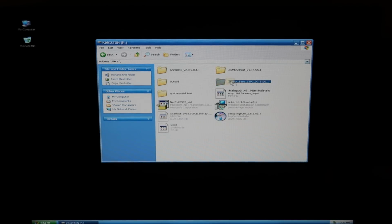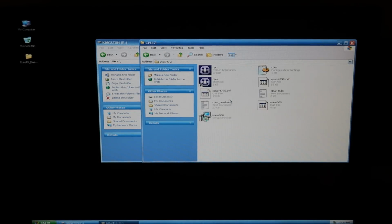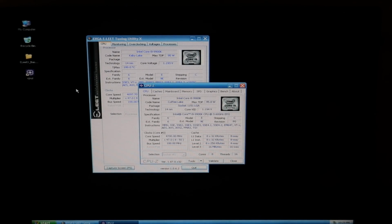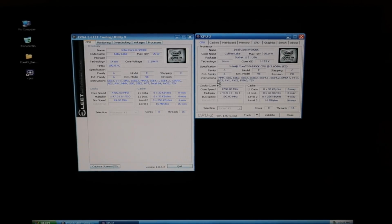So now we can take the ELEET basic software that is also compatible with Windows XP. I will also take the CPU-Z from D partition. So this particular ELEET software has compatibility in Windows XP. It doesn't require the Windows Management Instrumentation process running in the background in order to work, as some of the old and very stripped down versions of Windows XP do not have that service anymore available in the operating system. So we had to work around a version of ELEET that works without it. So this is an unofficial stripped down version of ELEET. I will have a download link down in the description below where you can download this.